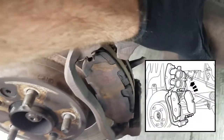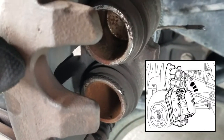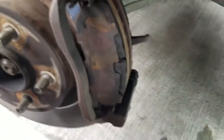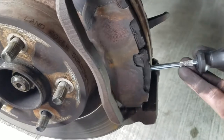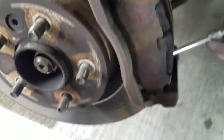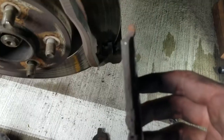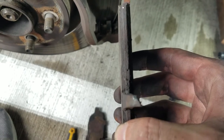Next, you can swing up the brake caliper. This is all you really need to remove if you're only replacing the brake pads, since you can access the pads easily at this point. Prop up the caliper so you can access the pads. Next, remove the pads — if they're stuck, you can use a screwdriver to help. Be careful if you're not removing the rotor, since the screwdriver might scratch. Looking at the pads, it's clear they are very close to completely worn, so the brake sensor was doing a good job indicating low pads.